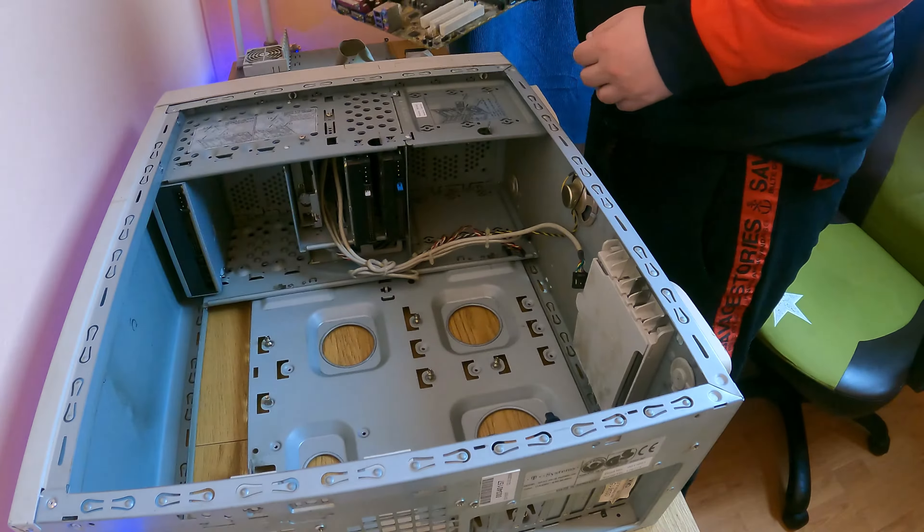The CPU radiator is going to need some cleaning, and as you're going to see, the CPU fan is also going to get an intense cleaning. Just look at this aluminum radiator — we've evolved so much in CPU technology. Nowadays we need special cooling for every powerful CPU. Remember, this Pentium 4 at 2.8 GHz was top of the line. All the components are in really good shape and not very dusty, so all I have to do is wipe out some really thin dust from the hard drives, floppy drive, and DVD burner, and we'll be able to put them back in no time.